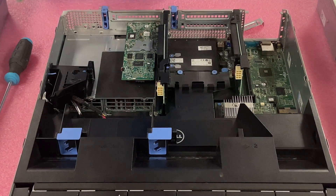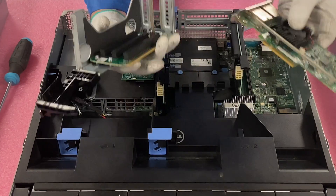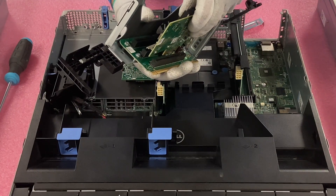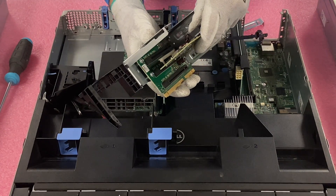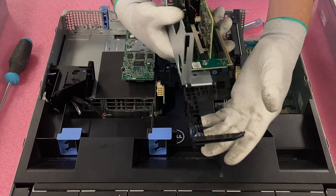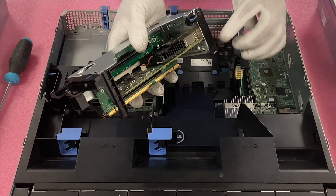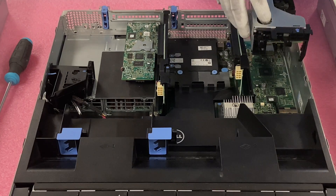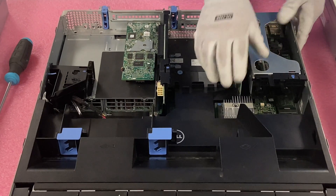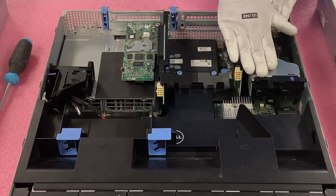We're going to line all of this up — make sure you have the tip that needs to go in and all the leads lined up. Those are the three things you really need to focus on. Come in here, get it all hooked up, and push it down. You heard it clip into place. Push this back in to secure it, lock it into place, and then reinstall riser 1. Honestly, it was a very easy installation process overall. That is how you do the PCIe version.